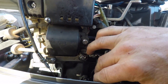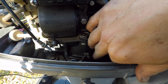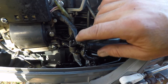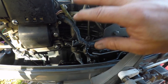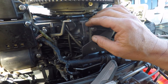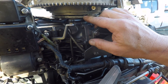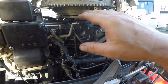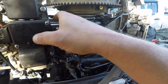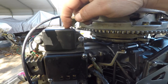You're going to have to go back and forth until you get the right linkage. If it's not very far off, you can probably just adjust this one until you get that 21 degrees before top dead center. It moves this bottom plate in and out — the trigger — going down into the switch box up here.